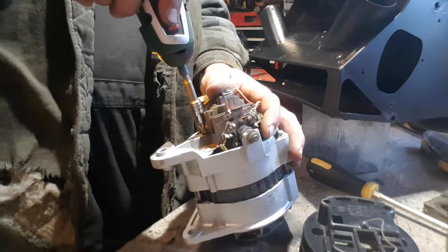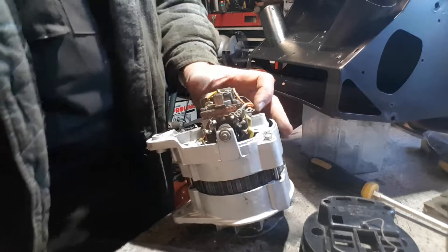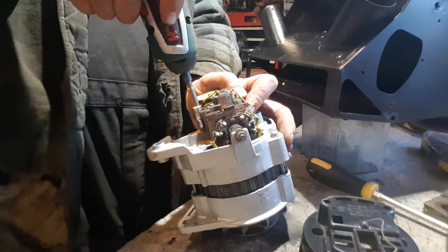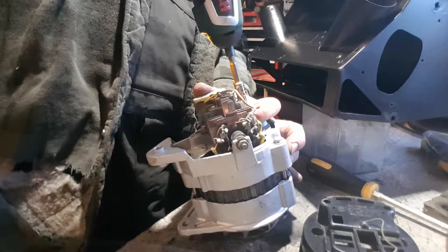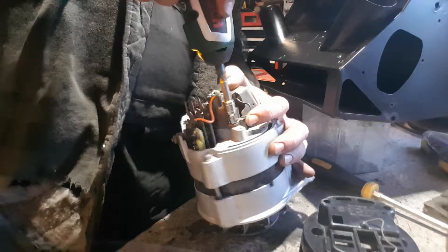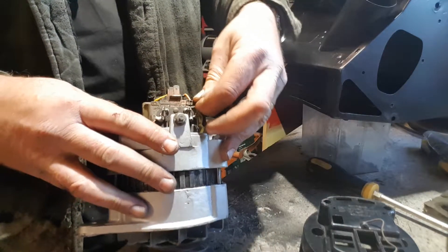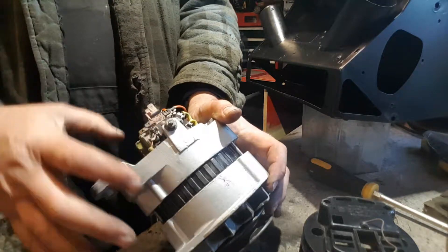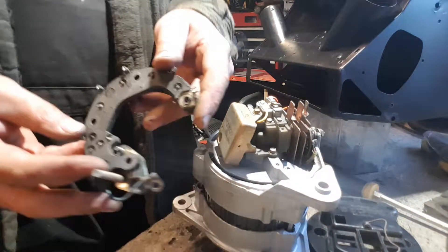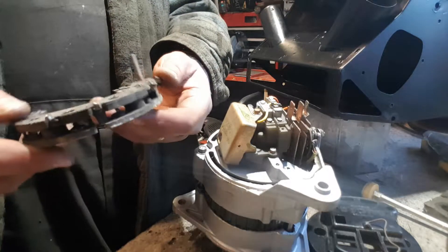I'm just making sure everything's lined up here. Make sure you put the wires back on — there's an earth wire that went to this terminal, I'm going to make sure it goes back on there. I can put the second wire in. The other wire, of course, is the positive, which I need to put back on to the diode pack at the front here. The diode pack sits here and it's these series of plates. Sometimes the diode packs don't look like that. Here's another example of diode packs from an AC Delco alternator — this is a more recent Range Rover. I've kept this because it works; the rest of the alternator was lunched but the diode pack was good.